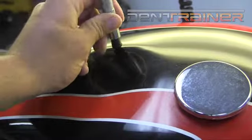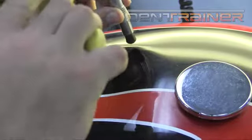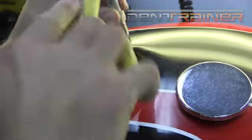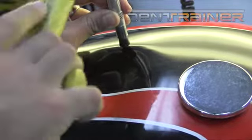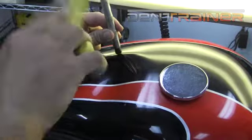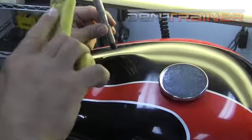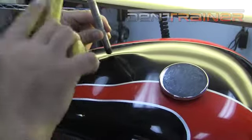Again, we're going to start out with this large crown. As you can see, I am using a soft tip. Definitely want some metal movement here — it's a pretty tight pinch. I really wouldn't be too surprised if we didn't find a nice line in the paint from that tight of a crown up there on a tank. So you can see I'm just kind of working my way down, softening the crown up just little by little. I also have the light going with the peak of the crown — that's definitely the way that I start it. We will be looking at it from different angles throughout, but that is the way I always start my crown work.